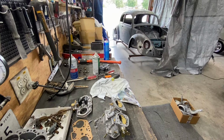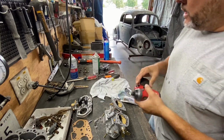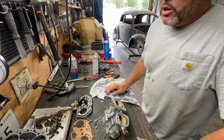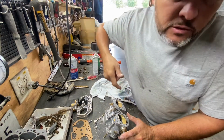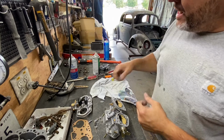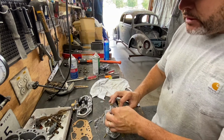If you want to take them out, just get an impact driver and use the flat tip, because the cross tip or the Phillips gets stripped. Then just put it firmly on it and hit it twice, and it's gonna spin out. So very important, don't do it by hand, because even if you have a really good screwdriver, it's not gonna work because they're really, really tight, okay?